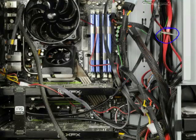Well, the video cards were still good, so I took those out to put them into the new motherboard when I installed it inside the case. Just make sure that you take care of these as well, and what I recommend that you do is you still take those out carefully, protecting yourself from ESD again, and then place them inside of the ESD anti-static bags.